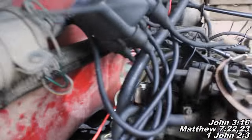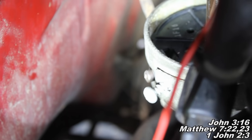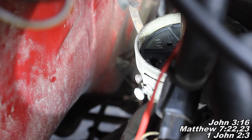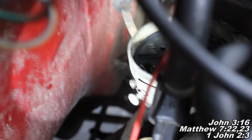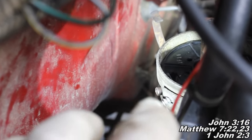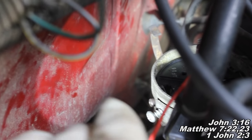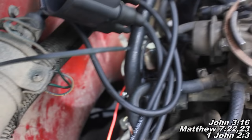Okay guys, the next Phillips head screw we've got here is going to be sitting right around here. You can see we have two Phillips head screws fastened in that place right there. You can see that smaller black one — that's the one you're going to want to remove. Also, we have that slightly larger silver-like Phillips head screw, but it's actually going to look identical to the other two screws. You need to make sure you grab the one closest to the firewall. Those are the two screws you need to take out — all three are going to look the same, but only the two I described are you going to want to remove. And then we will be able to remove our ignition coil pickup sensor.